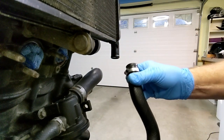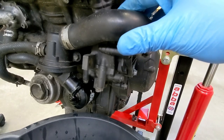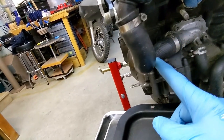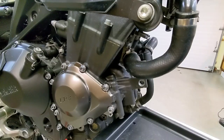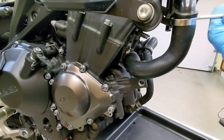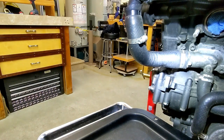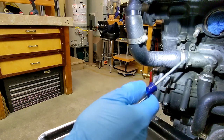That wasn't too bad. I squeezed this water pump inlet hose — a little came out before — but let's do the radiator inlet hose next. It's going into this water jacket joint; that's where it comes out of the engine block. Radiator inlet hose coming off. I'm just undoing this screw — water jacket joint, radiator inlet hose.